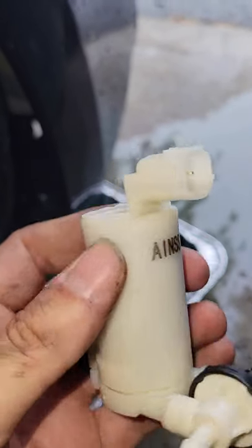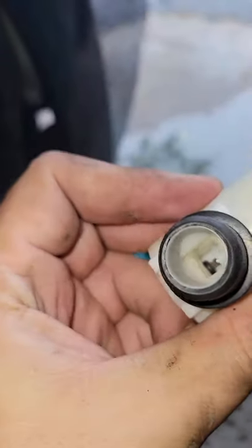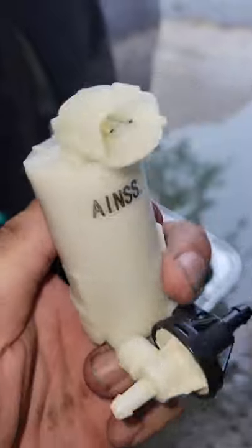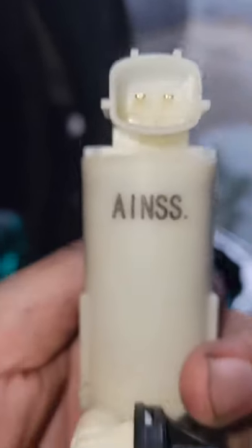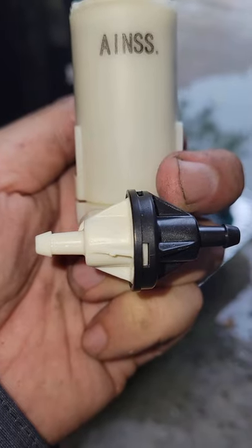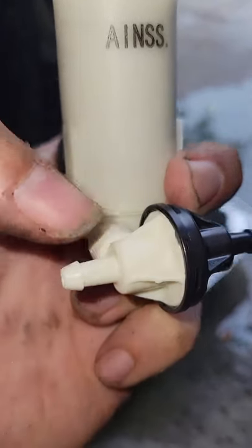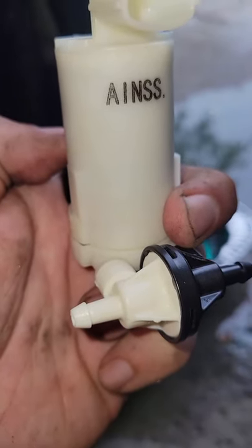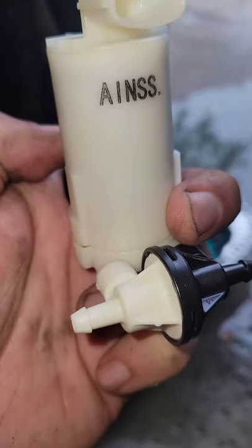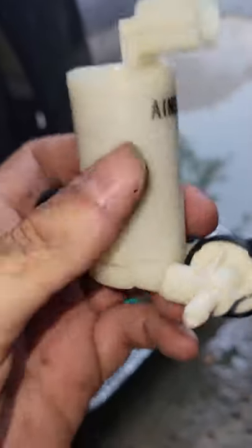So you can get a better look at it — this is the pump, and this is the new one. This big opening here with the rubber gasket plugs into the reservoir. The electrical connection plugs in there. And down here you've got two nozzles for output: one that goes towards the front and one that goes towards the back of the car. When the pump motor is running, it forces the liquid out the nozzles to whichever washer nozzle you're trying to use. It's a pretty simple piece. I paid $10 for this from China — I bought two of them, one is a spare — and including shipping, it cost me $56.